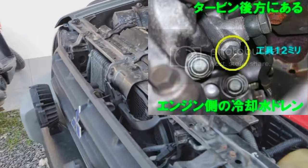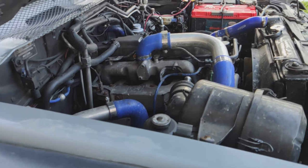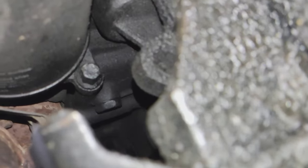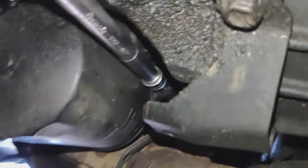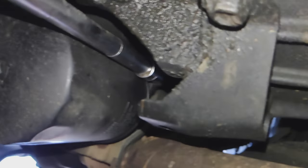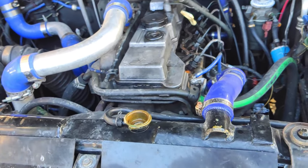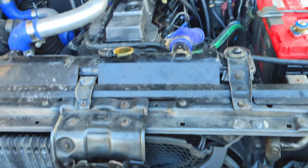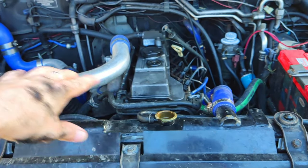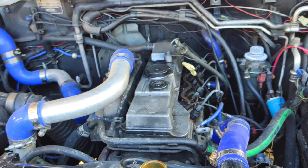Last night I stumbled across some images — one's a photo and one's a drawing — created by our Japanese friends, possibly 20 years ago. I'm going to crawl under here one more time and take another look. It is that thing — it's a 12mm. It turns but not easy, pretty resistant. I don't think it's been opened probably in a very, very long time. I've got my drain plug very loose and it might be just about to fall out. Now I'm just going to go get a bunch of water because I want to flush this as the engine's running and keep dumping new water through there, hopefully opening any blockages and getting this engine cooling a bit better.